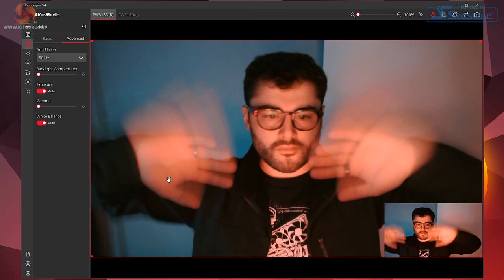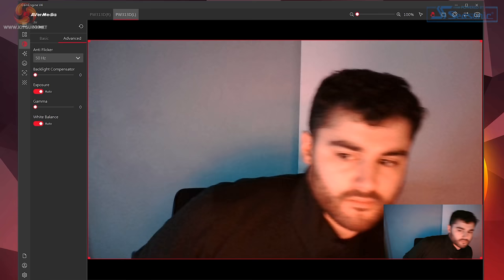One criticism I have of both cameras is the motion blur. Here's an example, and this is mainly due to the fact that the cameras are 30fps — whereas if you had a 60fps camera, you wouldn't get as much motion blur, if any. In low light, the motion blur is exaggerated even more, and this is likely down to the shutter speed. The software doesn't actually let you customise the shutter speed or ISO, so my guess is the shutter speed is slowing right down to let in more light and that's what's causing the excessive blurring. I don't really think the blurring is awful, but for something that's supposed to be a showcase webcam for teaching classes, having this kind of motion blur is very distracting.